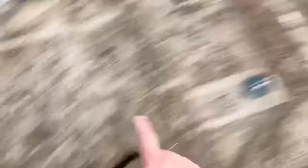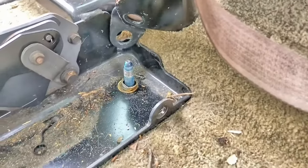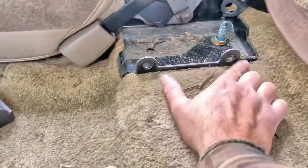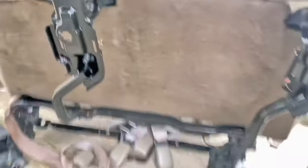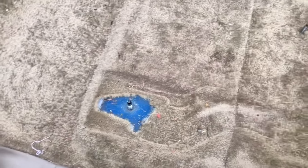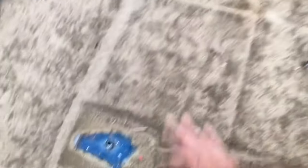Once you get the back seat loose, this is what you've got left. There were five main mounting points: one, two, three, that one over there that held the seat belt, and that one right there. So there's five nuts, two bolts — those two bolts were the ones right in this area. I just flipped the seat into the back. Now we're ready to pop this out and pull this carpet apart, and we'll be ready to make our hole right there.